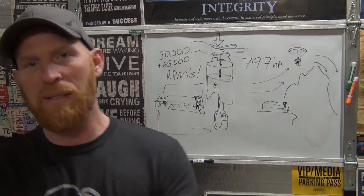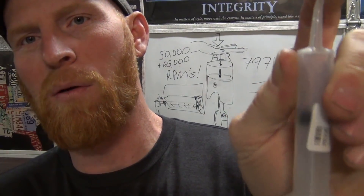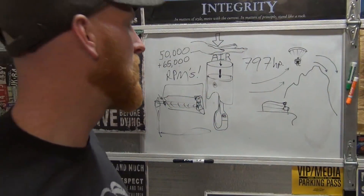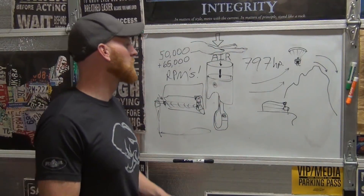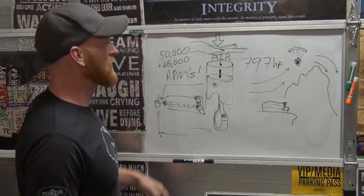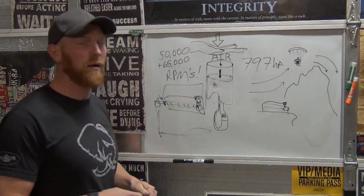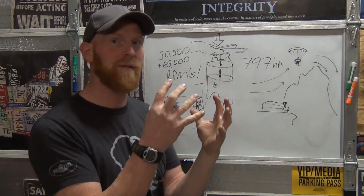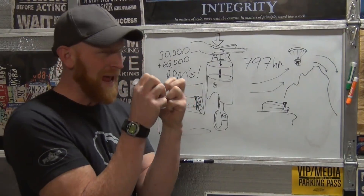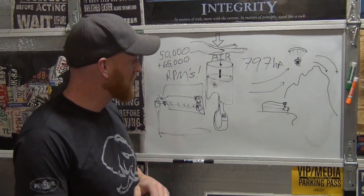Instead of having resistance when the piston goes down creating vacuum, if I open it it will stay down. You can have bigger intake valves, so you can have a bigger opening. Or you can use pressure — forced air induction is what they call it. That helps the piston go down and also helps to pack extra air so that when you do compress it, all your little fuel molecules are closer together. They have plenty of air to be in stoichiometric balance at 14.7 parts to one, where it just shoves that piston down as hard and fast as you can.